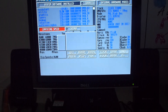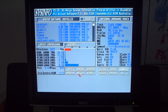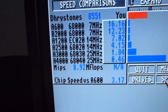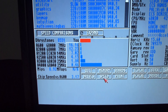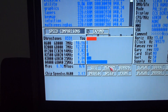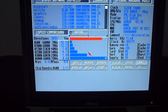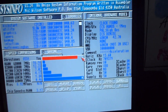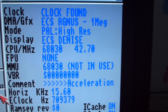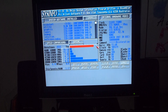Now if we run the speed test again, you can see it's almost double — getting 8,551 Dhrystones and 8.92 MIPS. So all in all, it's almost hitting double the speed it was before. If you look at the clock speed there, the 68030 is running at 42.7 MHz — pretty much double the clock speed it was before. And the machine handles it easily.